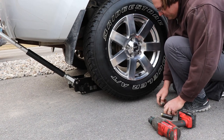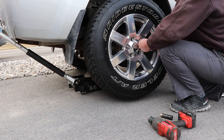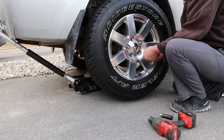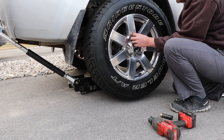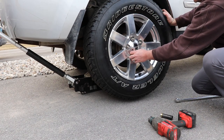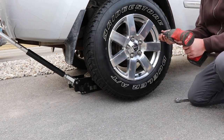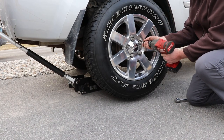I've done videos on how to mount wheels properly, so I'm not giving the full explanation here — I'd prefer you watch those other videos because there's a fair amount to it and you want to get it right. Don't start your lug nuts using your impact gun. You can if you're skilled, but if you're not you'll ruin the studs, so it's not worth it.